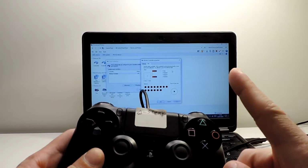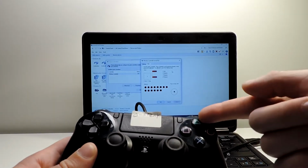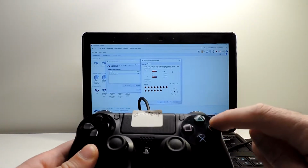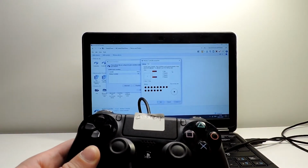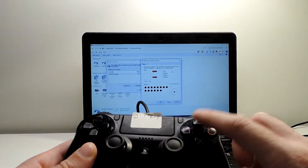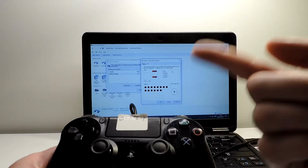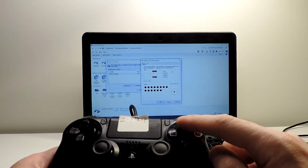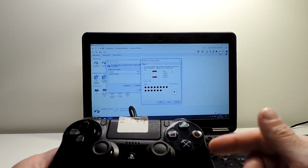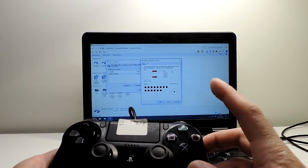I would say the first solution is to not even open the controller, just try to put some IPA in the side of the button and it will go inside, and maybe try to put some paper over here and clean it, but that might work. But as well, usually this kind of thing is sticky underneath the button itself. It would be better then to open and fully clean, but let's try both approaches and see what works best.